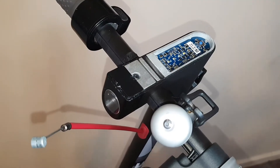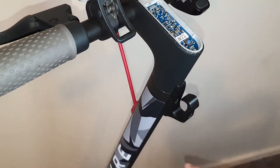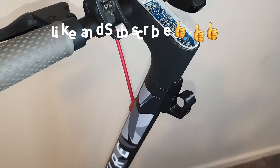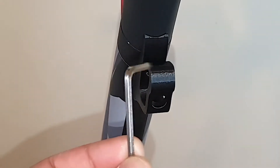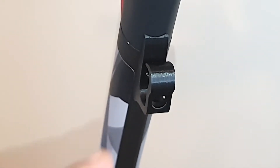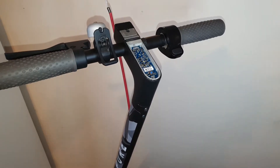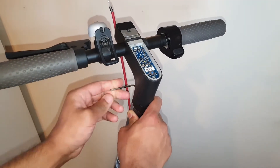The next part is that we need to turn the scooter and remove the two screws which are located here, which connect the top of the Xiaomi handlebars to the neck. For this part you would need the factory Allen key that came with your scooter, or if you don't have that anymore you can use the size 3 Allen key - all you need to do is remove the two bolts. Once you've removed the front back screws, there's another two at the front that you need to remove as well.